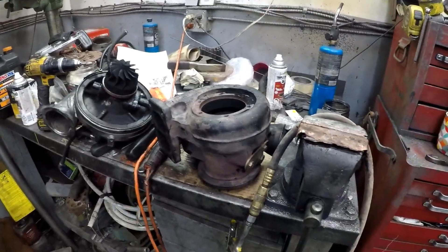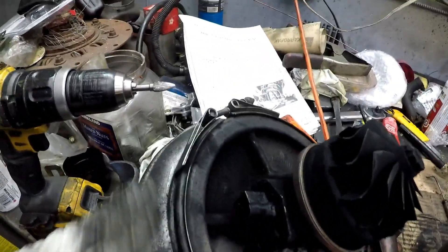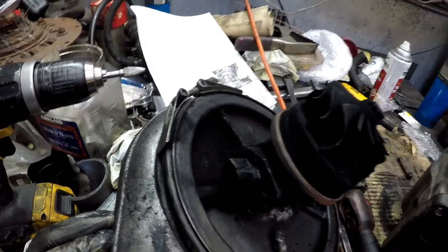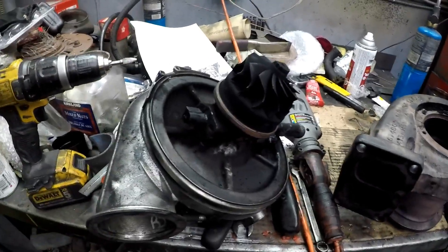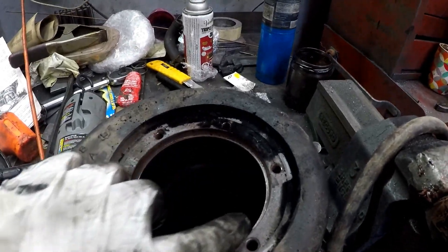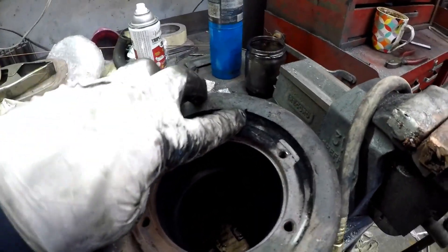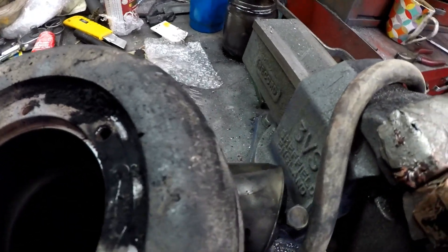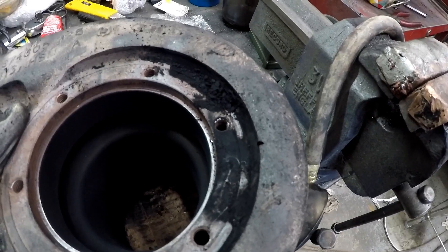Welcome back to the channel. I'm chasing up a turbo leak that I noticed had developed a few months ago but has been progressively getting worse. I took the turbo apart — this is a Borg Warner K31 — and there are no leaks in the flange, which was sealed. Then I noticed this: can you see that? It's a crack, and that's where I was getting an exhaust leak, which is also a boost leak on the exhaust side.